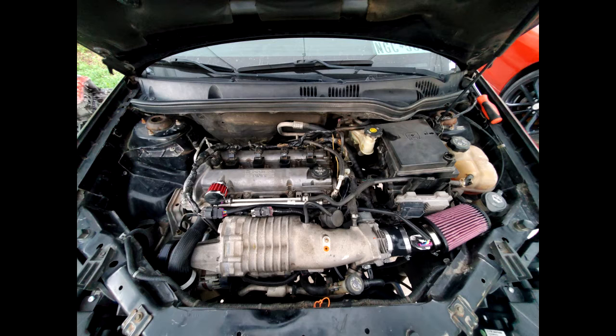The car is definitely idling a lot better and startup was better too. It is a little raspy and loud because there's an exhaust leak on the downpipe, which we need to fix. The owner is already getting a replacement downpipe, so once that's taken care of the startup will sound much better and we can finish the tuning. Until then we ran the driving log and grabbed a little boost. Once the exhaust leak is fixed we can finalize the tune — this guy is on his way to enjoy his newly supercharged LAP.